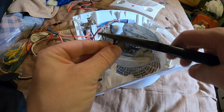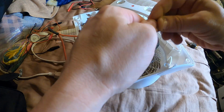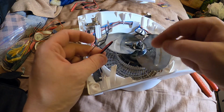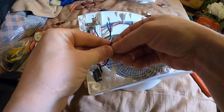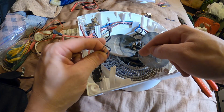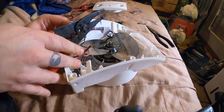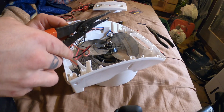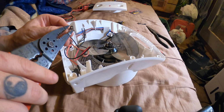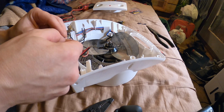Two heaters, fan and indicator light. These two smaller wires together: indicator light, fan, and one heating element, so one power switch will turn on all those, and then from the other side of the switch we'll connect another switch to the secondary element for high heat. Got all the old connectors pulled off and replacing them with ring connectors with non-insulated connectors